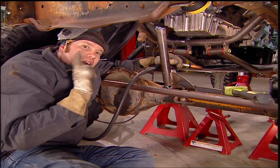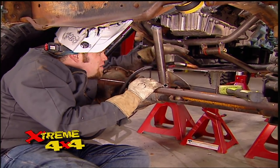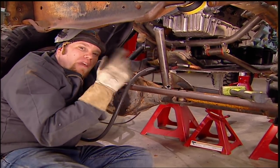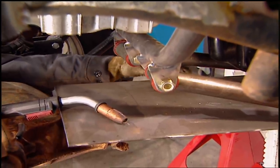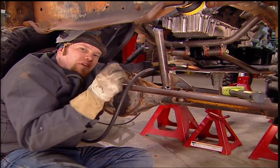The front mount of this skid plate is very important. You can see we mounted it on poly bushings, just like the rest of the crossmember for the whole drivetrain. If we'd just taken the skid plate and welded it to the engine crossmember, we'd actually be solid mounting the whole thing — which is a big no-no when it comes to the drivetrain. The plate still needs to be heated in the middle, cut to the shape of these tubes, and then fully welded, but that's going to be a lot easier when the engine and transmission are out of the truck, so we'll do it later.